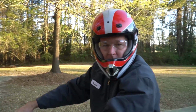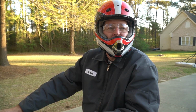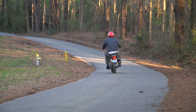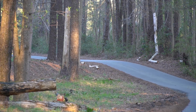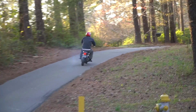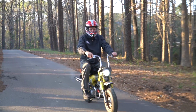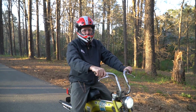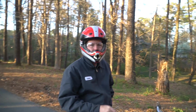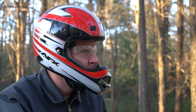How's it running? A little cold natured. I'm going to take it down the road and check out the speed. Sounds good. I'm not going to go crazy because he's actually moving pretty good. How's it doing? Keep it at idle. It's a little bit on the lean side, dude. Lean, okay. Well, we can adjust the carburetor. That's no problem. Sweet. That's where the hiccuping is coming from.